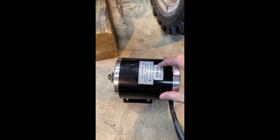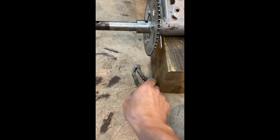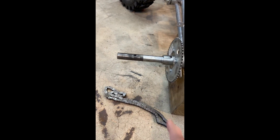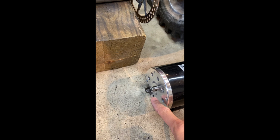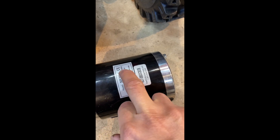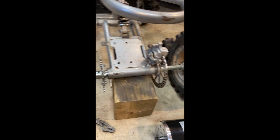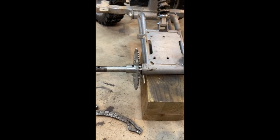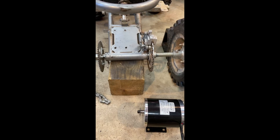Here's the new motor - it's a 36 volt 500 watt with a rated RPM of 2500. The Razor quad runs an 8 millimeter chain, and I have a chain tool to disassemble and add new links as needed. It's got a 10 tooth pinion combined with a 54 tooth sprocket and 13 inch tall tires. At 2500 RPM that puts it at about 18 miles per hour, which is probably a little too fast, so I'll likely need to adjust the gearing.